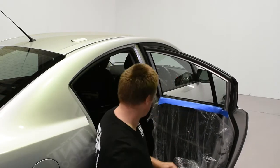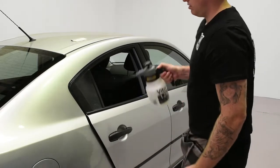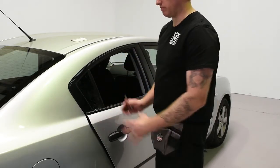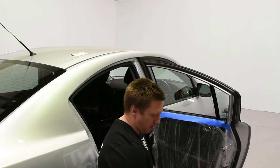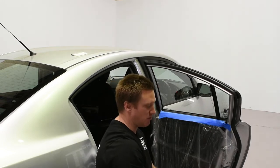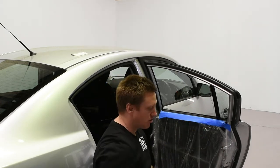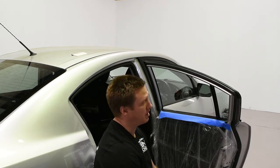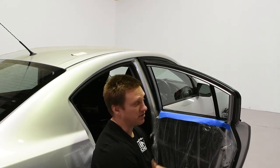Now we're going to clean the outside. Generally you could use a scourer or a squeegee to clean this off, but this car is quite clean because we've been working on it a little bit. This had film on it so I'm going to use a stainless steel blade to remove that adhesive. However, it's a brand new car — sometimes I prefer not to use a blade because the inside of the glass can be quite soft and scratch easily. In that case you'd use steel wool or a scourer pad. From what we've found, the newer the car, the softer the glass, so just be careful.